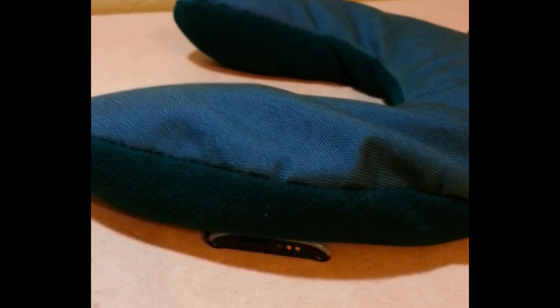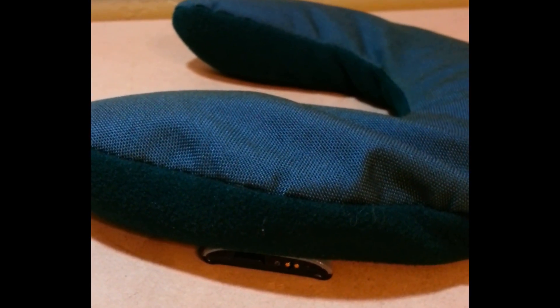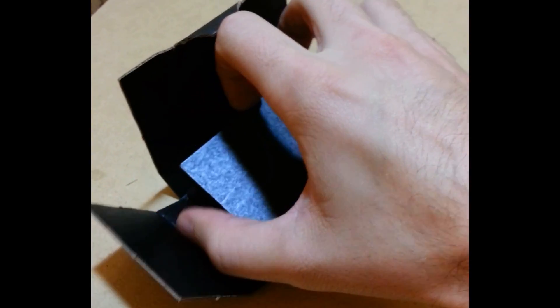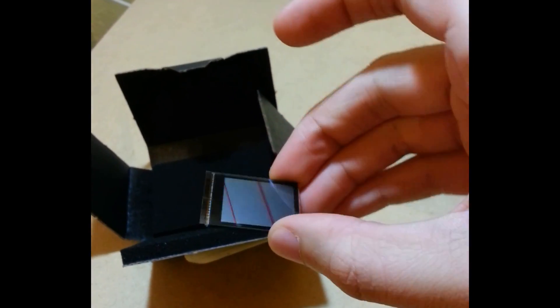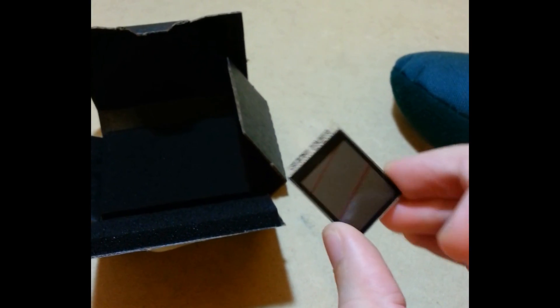This is my substitute for the heating bag from iFixit — just a heated neck pillow, so hopefully it will transfer heat and help crack the case open. This is the screen from Mouser. It's the exact same model used in the actual Pebble. As you can see, there's a film on it — that's what those red stripes are — so I'll have to take that film off before putting it in the watch.